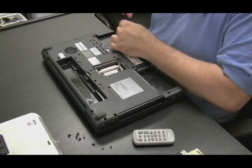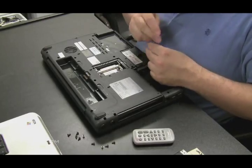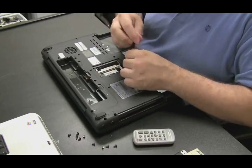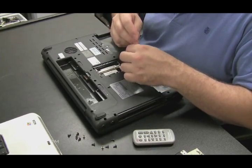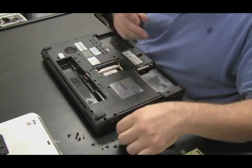Look at the motherboard in every little crevice — that's what I recommend on water damaged laptops of any sort. Don't power them on, and even when the customer comes in, don't let them power it on in your shop. It can't get any better if they're trying to charge it with power.